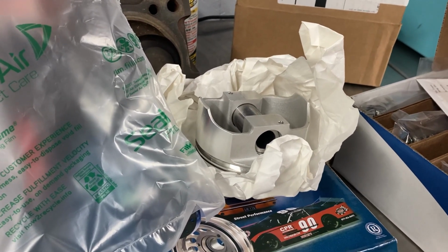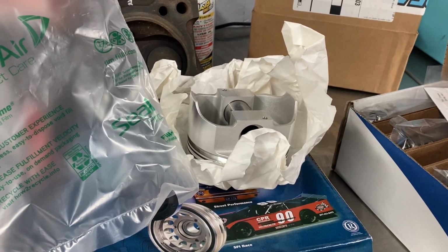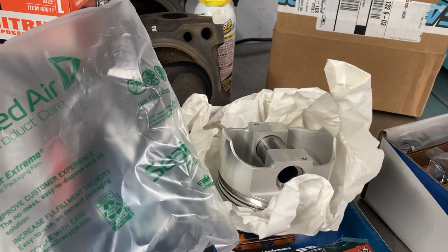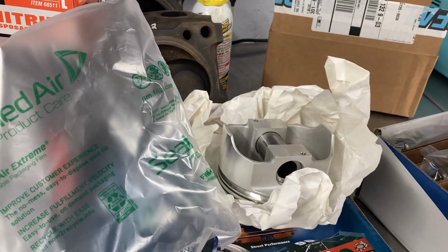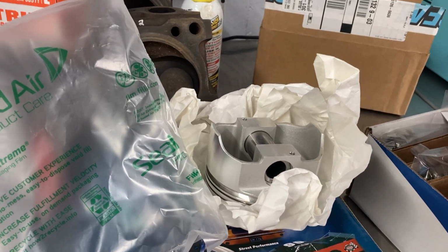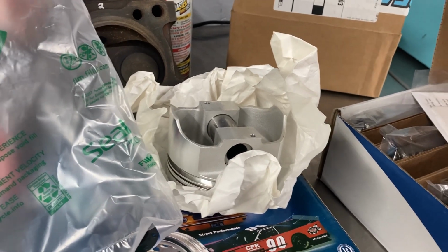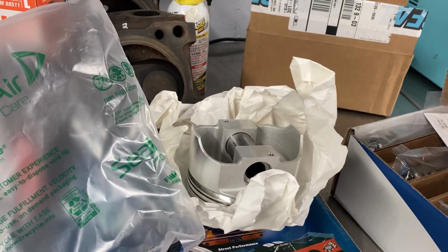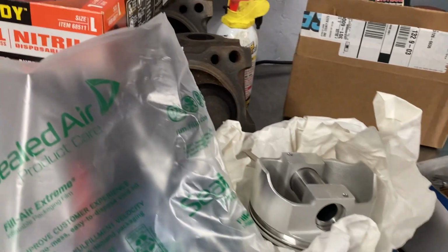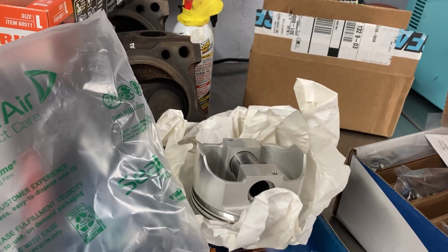Steve Magani did a magazine article on it, and I guess they got some good numbers out of it. They got 462 horsepower, and then they did a version with just plain number 17 heads and a milder cam, and they got like 371 on that. And both times the torque was well into the 400 foot-pounds range. So they could be a potent little engine. Unfortunately, I think he was trying to challenge Butler at the time, one of the main Pontiac engine guys around. But somewhere along the line, he lost interest, and last I knew, he was growing organic food out in California. Go figure.